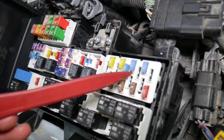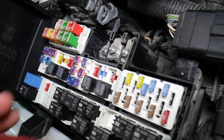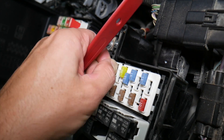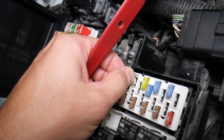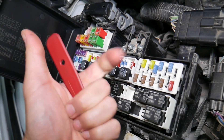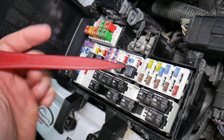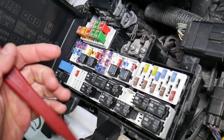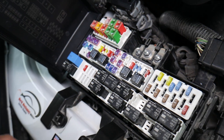On those fuses, you cannot clearly see if they're burnt or not — especially with J-case fuses as well. If you assume a fuse is good just by looking at it, but it's actually bad — sometimes you simply cannot see that — you could put the bad fuse back in and start replacing parts and tools you don't need. You'll lose time and money fixing a problem that doesn't exist, when all you need to do is test the fuse and replace it. We'll put a link in the description to a special video that will teach you how to test fuses and check relays very easily.